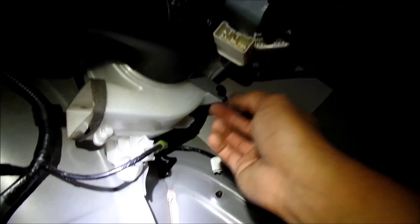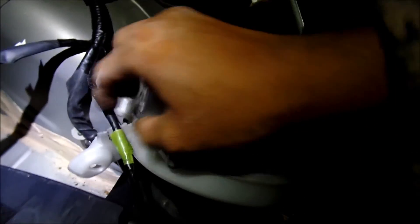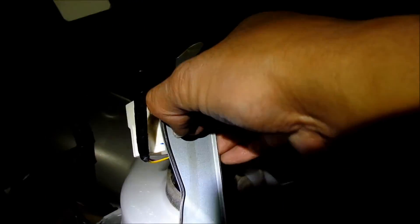After that you can go ahead and pull it out. There's going to be some wires connected to it — you gotta disconnect this. There's a little clip that unclips it right here. Then just take the blower out like so. There are two wires connected to it — this one just has a little clip that you gotta undo. It's hard to do one-handed; if you have trouble just use pliers, but there you go.